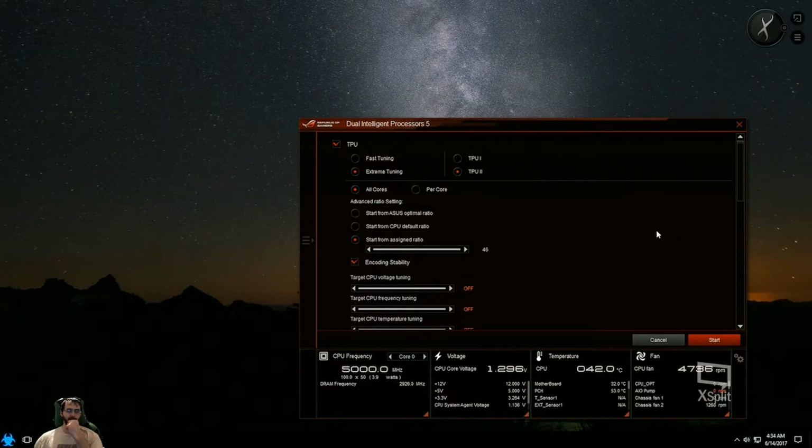Honestly, if you want my opinion, I think you should stick with the BIOS stuff that I showed you earlier, and just do it that way. Set your fans and everything in your BIOS to a static percentage that you're comfortable with, and then adjust your AIO fans with a curve. Then you'll leave your fans alone and just worry about your CPU overclock. And when you find a stable CPU overclock with your fan profile and everything the way you like it, then play with your RAM. And when you get your RAM where it's not freezing the computer, then you're good.